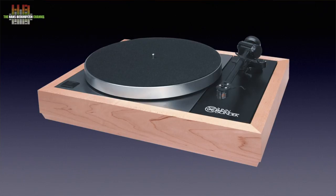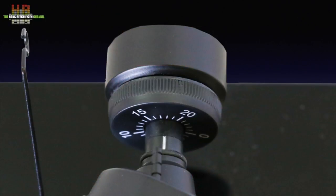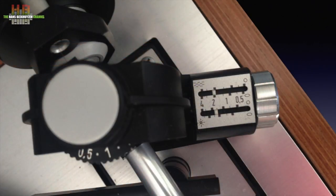Even worse is when sound energy excites the shelf the turntable is on, since chances are the shelf is not designed to fight resonances. Therefore, some turntables, like the Linn LP12, have a platter and tonearm base mounted on a suspended sub-chassis. Others fight those resonances by pure mass — a heavy turntable base will absorb a lot of energy. Still, it is advisable to place a turntable on a very sturdy surface that is almost free of vibrations. It almost always needs to be 100% horizontal when it uses gravity to set the tracking force and anti-skating, and often the bearings also work better when the turntable is level.